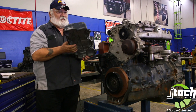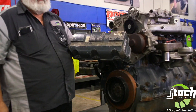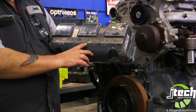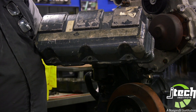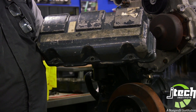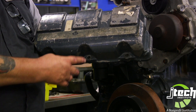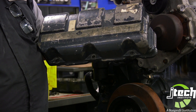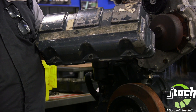Part of what I want to show you is actually on this — if you can zoom in on this. You'll notice on here that it gives you a valve adjustment. You have a hot adjustment and a cold adjustment, but all Mac engines give you a cold temperature adjustment. So this one would be 16 for the intake and 24 thousands for the exhaust valves. I'll go through the procedure and show you how to do those.